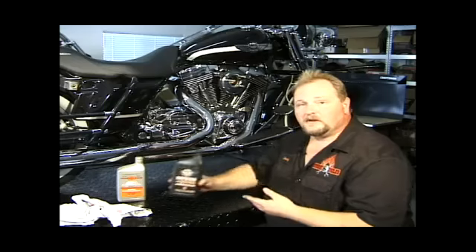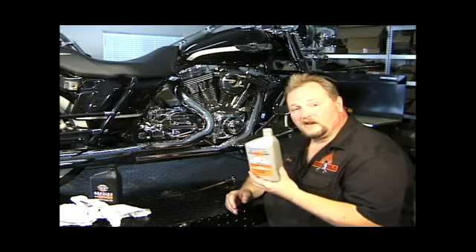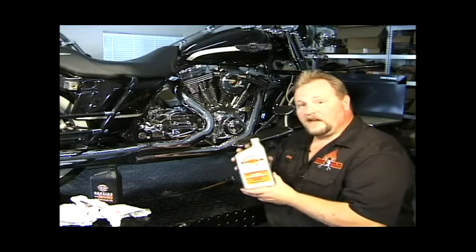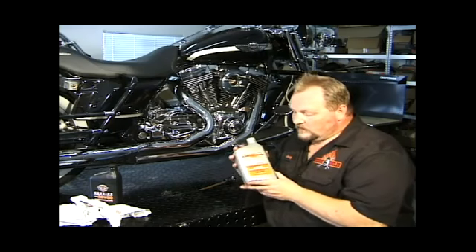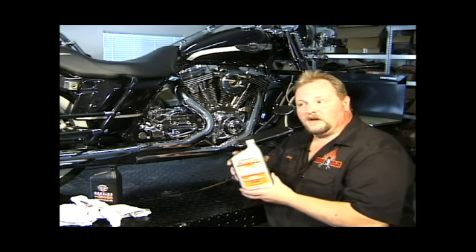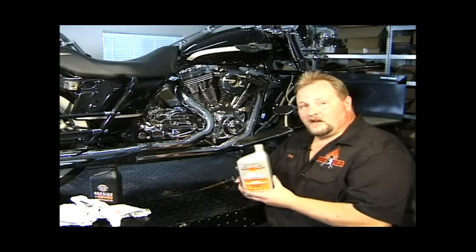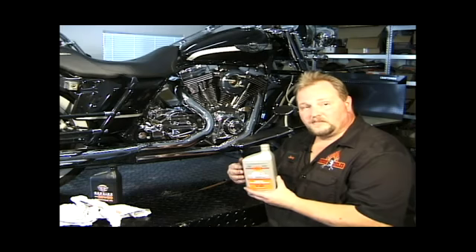That's great, but I prefer synthetic oils. This one is a Syn 3 partial synthetic oil. It's thinner, so it cools down quicker — it cools your motor quicker. The bike will run between 10 and 15 degrees cooler with synthetic oil than with a fossil oil. One drawback is that it doesn't dampen engine noise as well because it's thinner, but the trade-off is faster cooling.